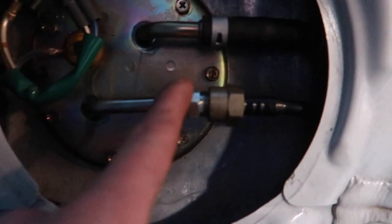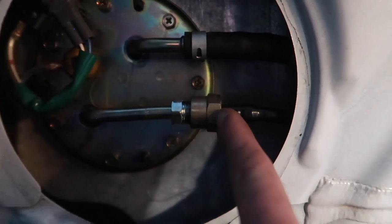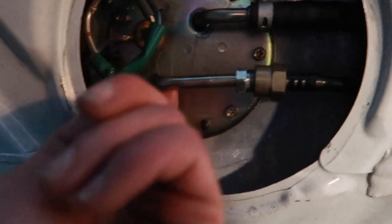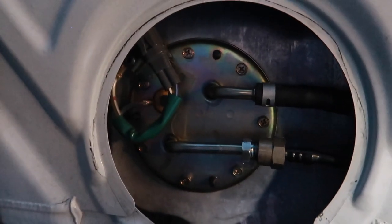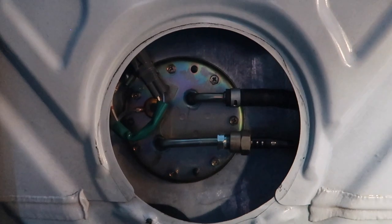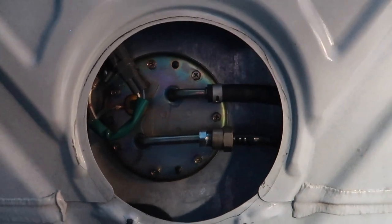On this bottom hose, use your tube line wrench on the male side — pull up to loosen, then hold the female side in a fixed position. It looks like I'm bending the hard line and potentially kinking it from the fuel cradle, and I really don't want to kink this because fuel won't flow efficiently. I honestly don't know where I can get a new fuel hanger for the JZX100. At this point I'm letting the bolt soak in PB Blaster, heading to the gym, and I'll give it a couple taps with a hammer when I come back and hopefully it loosens up.